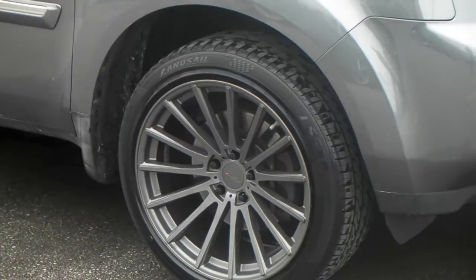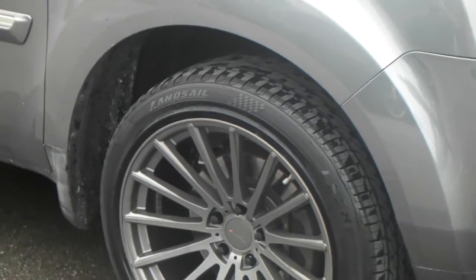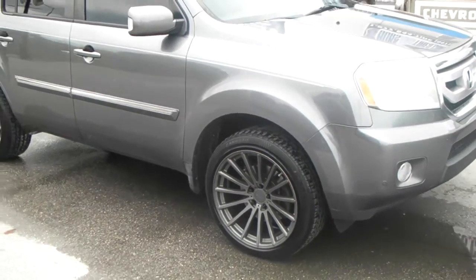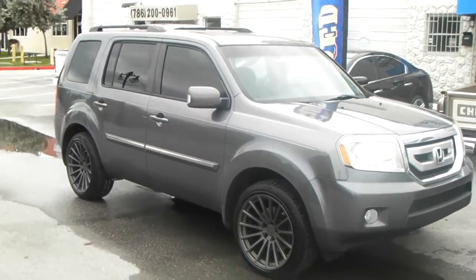You can see the tire right there. This vehicle is going to be lower, so it will not have that gap. You see that gap — you can actually go a little bigger. You can go with a 245-45-20, or maybe even a 255-50-20 if you want to completely fill up that wheel well without dropping it.